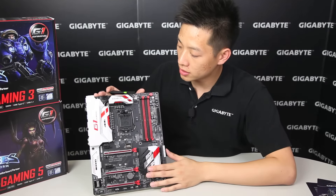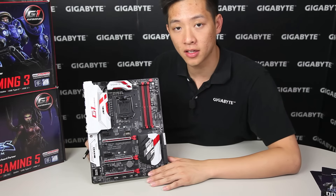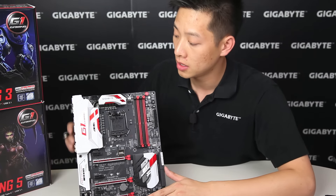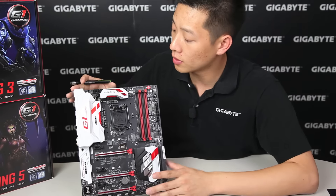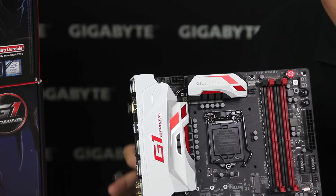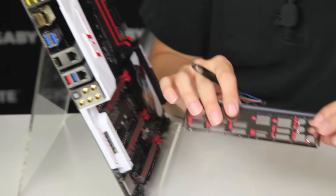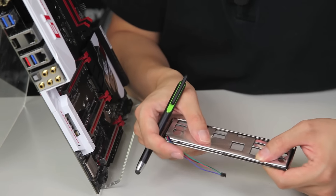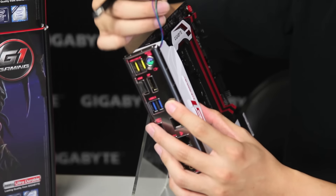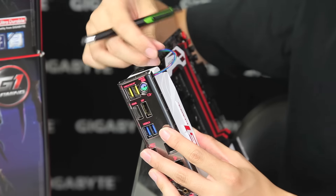Alright guys, so let's break it down on the board. We'll go over the board and then we'll talk about the rear I/O. If you guys have any feedback you want to share with us, definitely reach out to our Facebook page. You can find out more information on gigabyte.com. So right off the bat, you can actually see some connectors here — there's a four-pin connector for your rear I/O. You guys might have seen this previously with our X99, where we actually had a backlit I/O that's padded, which is very nice — it gives you a premium feel and it's backlit. Instead now, we actually have four connectors off of it. You can actually see there's the red, the blue, the green, and then a black for your ground.